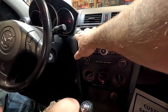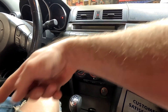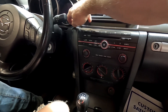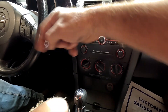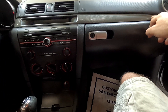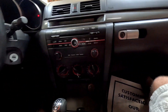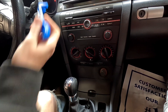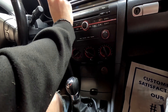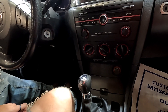All right, so here's the radio. This little plastic piece right here needs to come off. What we're going to do is take your little pry tool — probably that one first. And she already broke it. Anyway, we're going to pry this up a little bit so we can get the other tool in. It's just a couple of clips — a clip, a clip, a clip. And then this one down here, don't pull out, pull that way. Go ahead and get that off.